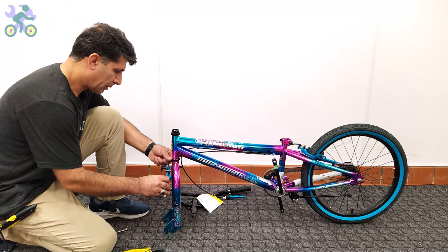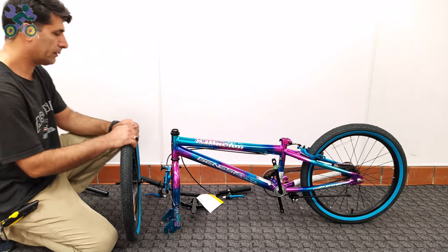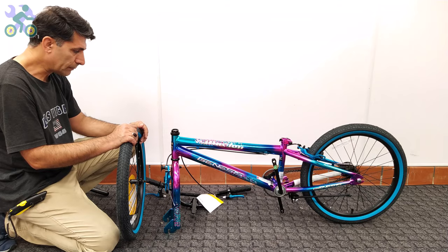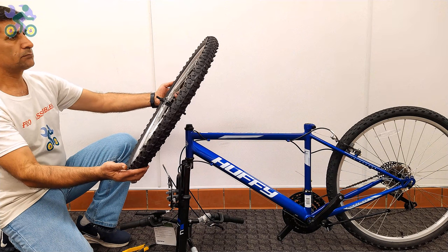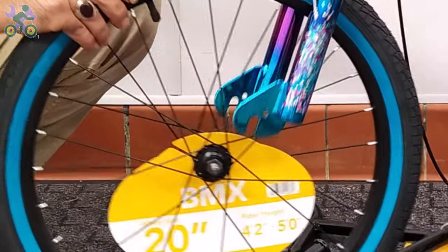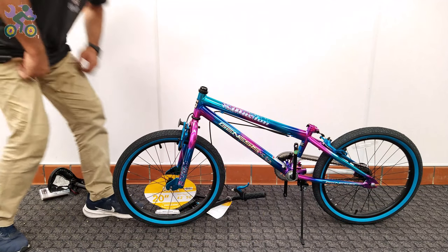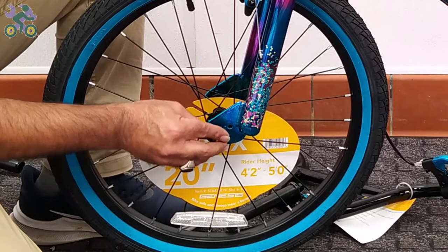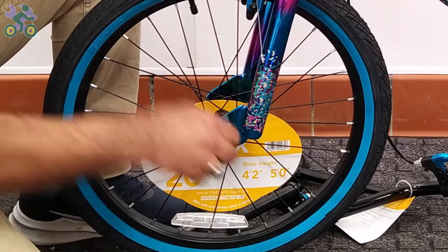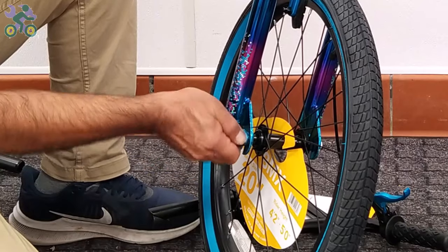If present, remove the plastic piece from the end of the fork. To determine the correct direction, turn the fork so that the brake system is facing forward. Check the tire and if available find the direction of rotation marked on it. Lift the bike frame and place the wheel axle in the fork, then open the kickstand. Insert the wheel retainer into the hole at the end of the fork and tighten the head nut by hand. In a few limited models only washers are used for the wheel retainers. Repeat the same process on the other side. If the rim is warped or bent, I've made a video on how to fix it with a link in the description below.